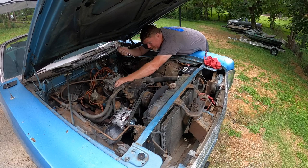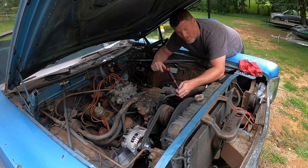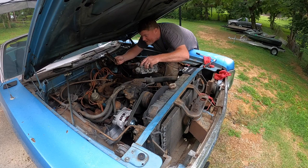These bolts are barely, barely engaging into the intake manifold. Originally, Marsha came with a two-barrel on the 318, not this four-barrel. So obviously, someone swapped out to the larger four-barrel intake manifold sometime during its life, and didn't do a really good job putting it on. That is finger-tight. No kidding. I had one tight bolt. No wonder we had vacuum problems. Look at our custom vacuum block-off — it's a plastic golf tee.